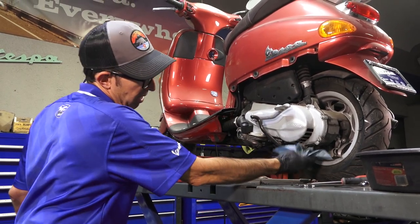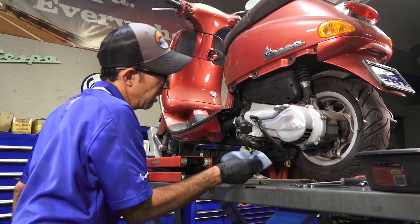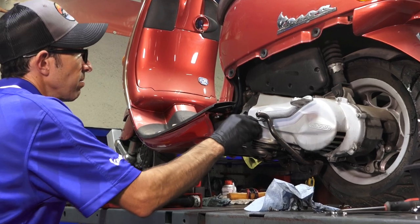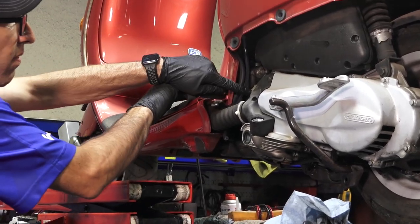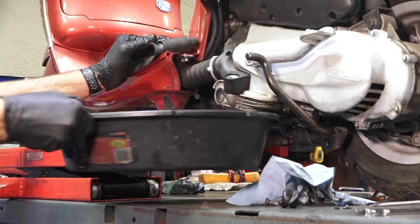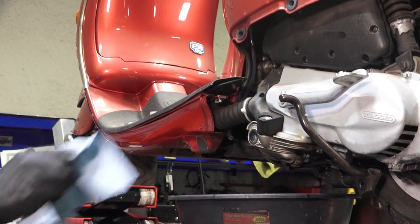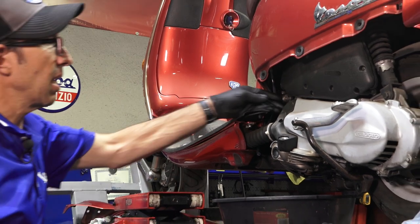Eventually we'll probably look into this oil leak — it might be the rear end or an oil leak inside the transmission. Another thing very unique to these scooters: they've got no dipstick. They do have a cartridge oil filter right on this little housing here. Have the oil pan handy — it's pretty messy to change those little oil filter cartridges. We still have those in stock at Scooter West, even though the scooter wasn't really sold in North America.